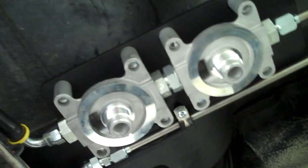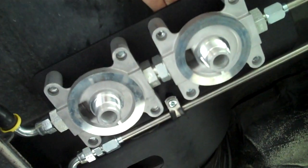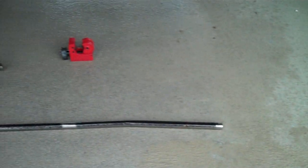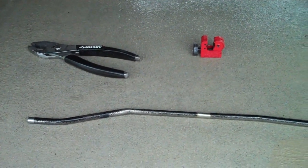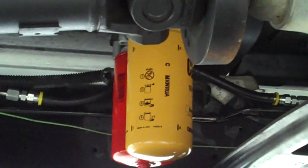This is the stressful part — cutting the fuel line. I know it's probably going to be simple, but I've never done it and there's always a little anxiety. Other than that, the system has been a complete joy to install. Minus that one nut, everything is simple, straightforward, and easy. I just cut out that section of fuel line — it was tedious. A good portion of fuel poured out, probably about 16 ounces. My arms are covered in diesel. Now I'll put those compression fittings on, attach the fuel lines, put the filters on, and we're done.